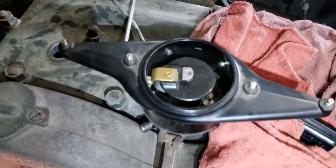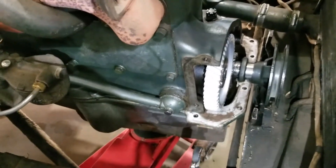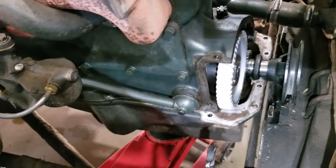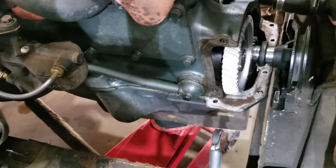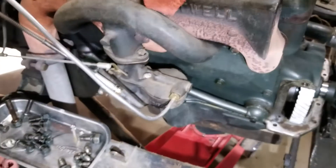Once I tried to get it to start and it would not start, I took a little peek inside the distributor and you could tell that the timing was off. So I found that gear all stripped on the inside. Seeing that they were doing an update with the aluminum gears, you know — keep working away on this thing. You guys have a good day.